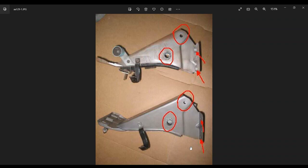Unfortunately this kit does not provide you with a new bracket and does not have you drill out these nuts. It has you try to put bolts through the firewall into the bracket from the engine side, which is very difficult to do. While these brackets are bolted in securely on the firewall, you cannot remove or insert the bolt at the top which holds in the power brake pedal. These bolts have to be removed or severely loosened in order for the bracket to wiggle enough to get that bolt out.